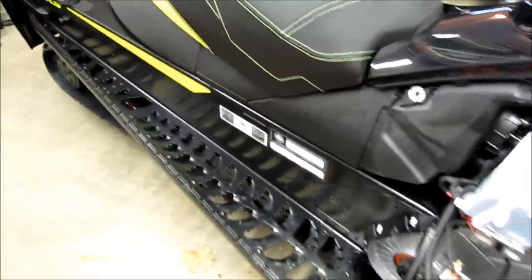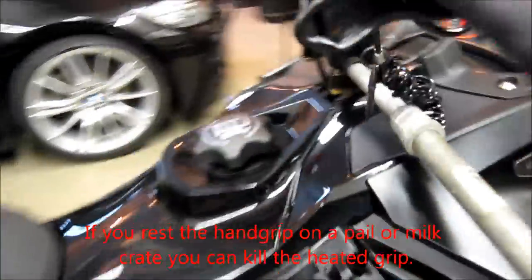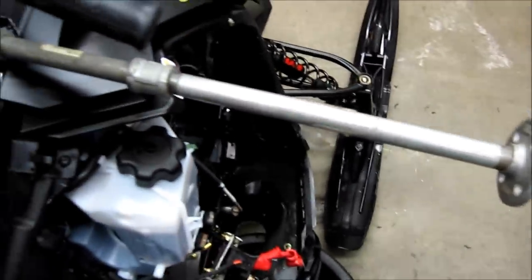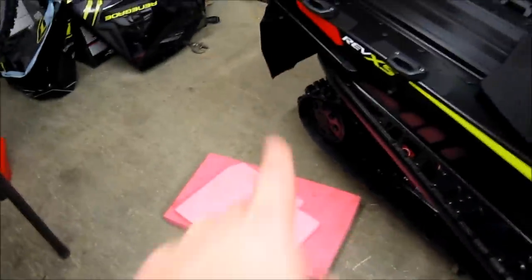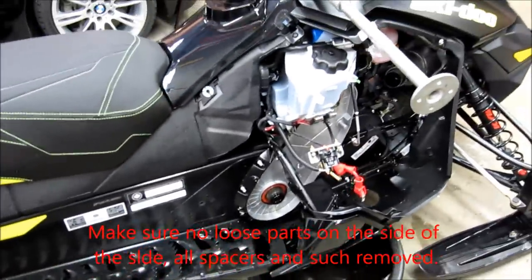It's really not that challenging. Then we'll tip the sled over onto a stand made with plumbing parts — it just pushes into the hole at the top of the steering post, which Ski-Doo has on all their XP and up sleds. It's just tall enough so the mirrors, side panel, and all those things won't hit. On the back of the sled, put down a piece of foam on the ground so that the back edge of the tunnel will rest on the foam and nothing gets scratched, then tip it up on its side.